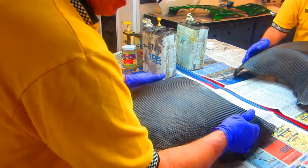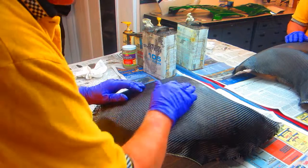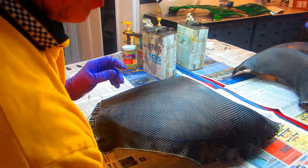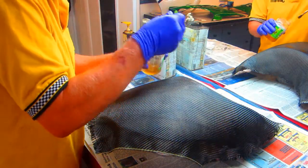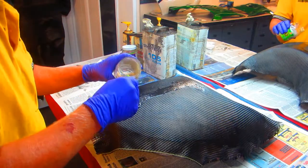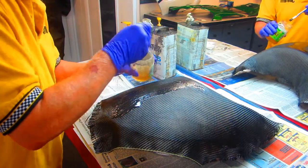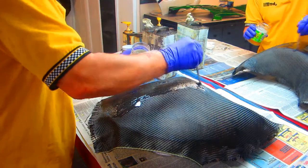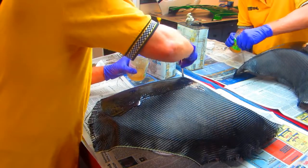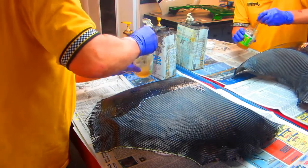The good news about West resin — if we were doing this with Epon, we'd have to have a fan going and be doing it outside because it's toxic. This resin is really pretty inert relative to all the resins I've used. We're going to laminate this part down and make sure we get a good soupy mix of resin on here. The mix on this is West 105 — five parts of that to one part of 206 hardener. I use slow hardener to give me a little more working time.